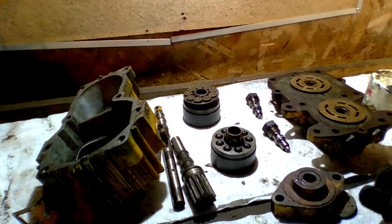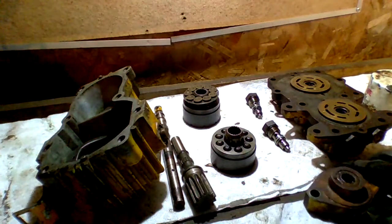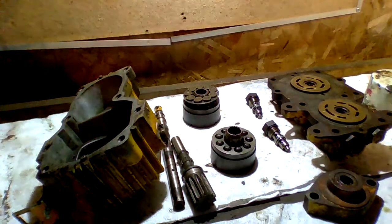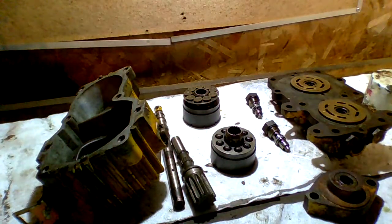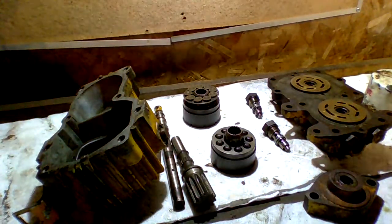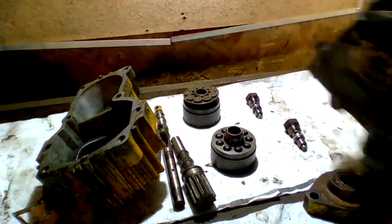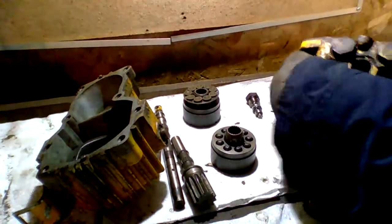This is the old hydro pump out of the 107 I have for you here tonight. Let's get right into it. We start out, of course, with the reservoir for the fluid. That's in the cast iron transmission case, which I don't have here with me, but from there it gets sucked up through a long cooling tube or a short one, depending on what you have on your tractor. This had a long one on it. And that gets pulled into this part at the bottom here.